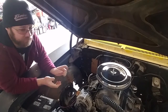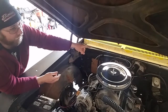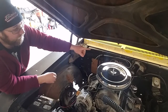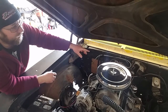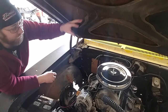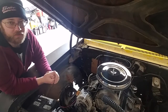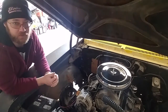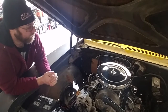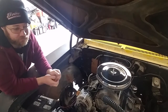But the vent tube that we're referring to is on the transmission. It's just a Turbo 350 or TH350 transmission, whatever. That tube is on the driver's side, just kind of up on the bell housing area. I can crawl under the car and reach up under there, kind of around my header, and I can get to it. So I crawl under there, and I got a drill bit and a little screwdriver and stuff, and just crammed it in there.